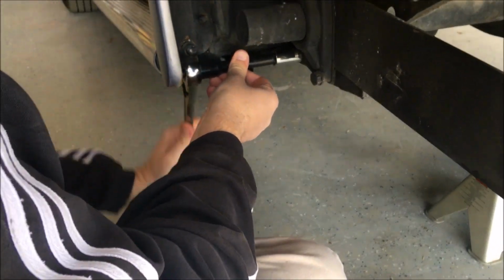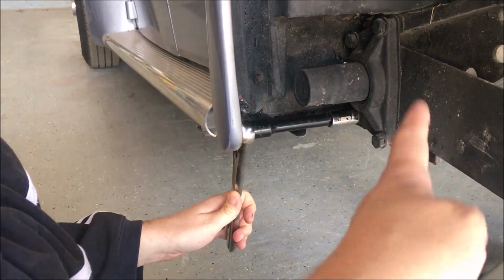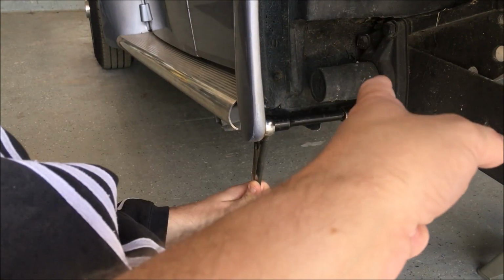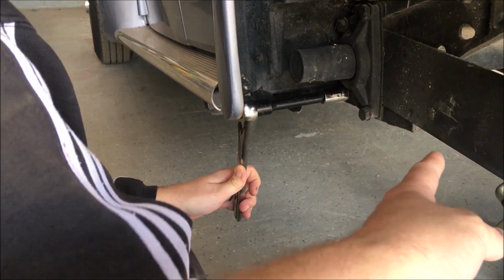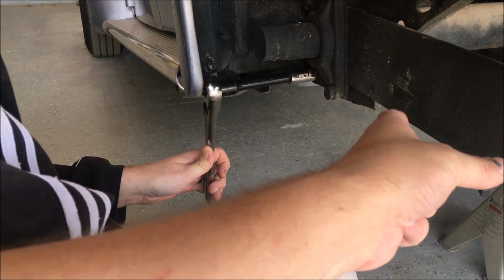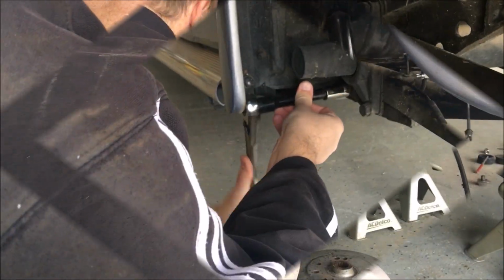my brother's starting to take it apart right now. But if you notice, this arm is actually already below that stopper. And it's interesting because I wondered before we started doing the car, if this side was higher. We actually measured the passenger side and we screwed up and didn't measure the driver's side to see what kind of drop we would get. So this one might actually take 2 notches to get it to the correct height that we need, but we're going to play it by the control arm in relation to that lower stopper there to see if we can get it evened out.